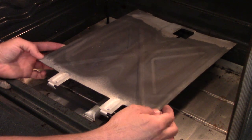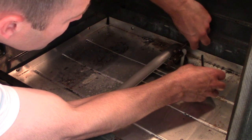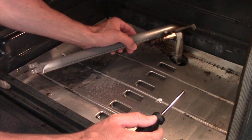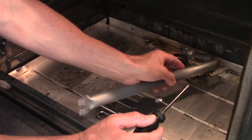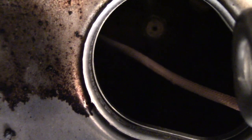It's not cool but it's probably cool enough, so I'm going to pull this plate — pull it forward to release the front pins. There we go, it kind of fits in almost like a puzzle piece back there. I'll pull it — you don't want to pull the wires too hard. Let's take a look down there. See that hole right there? That's where the gas comes out. You want to make sure there's nothing clogging or blocking that — if so, get a little pin or something and clear it out so the gas can flow.